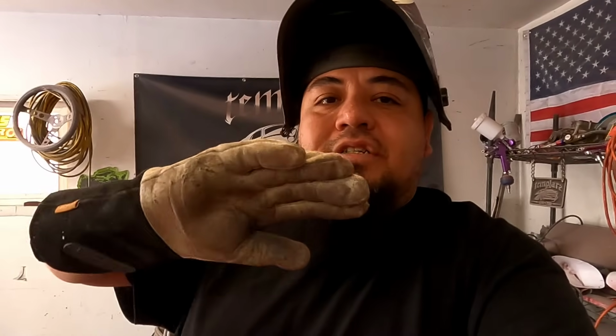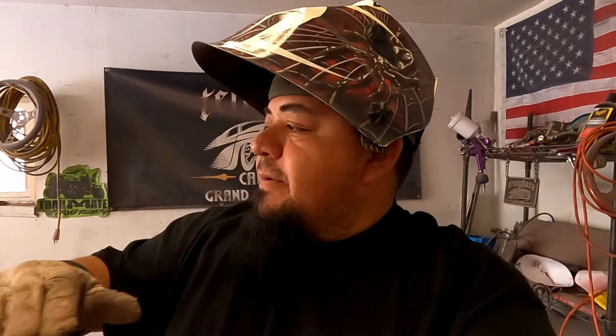I made sure that it's not twisted. So the piece that I made wasn't twisted. Where I made it, the body was twisted, and I made that piece to that body. It wasn't that far off, and I was trying to pull it, and I just couldn't get the kink out of it. So I went ahead, cut that out last night, and then I took that strap with those washers hooking on there, and I pulled that little bend out of the body. It's just the slightest little bend.